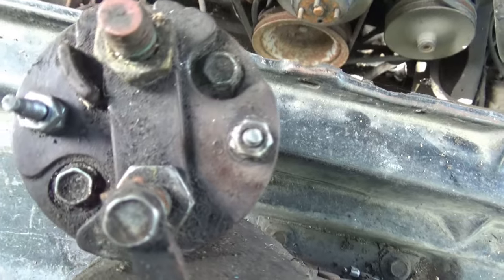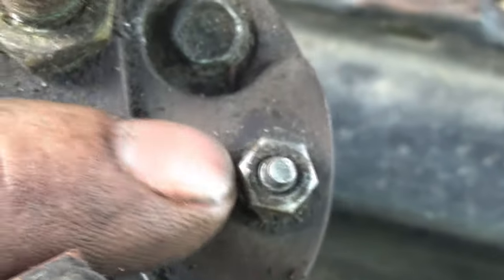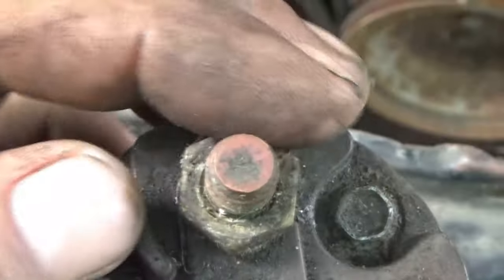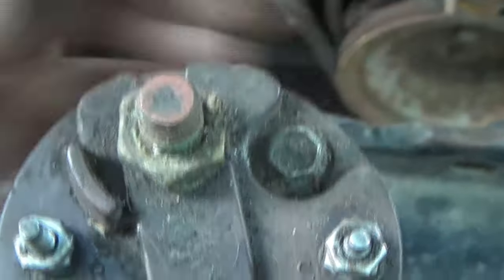You see that closer one? It has an S on it — that's for the switch. The one that has the R on it is for if you have points; don't even worry about it. So your wiring harness and your main big cable go right there.